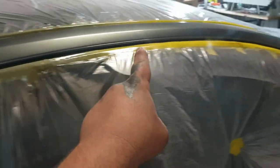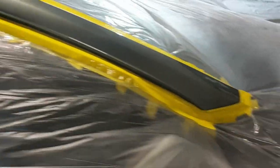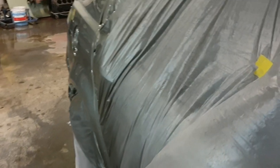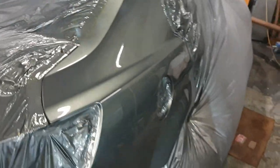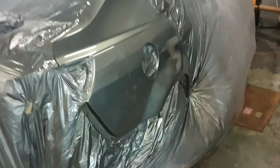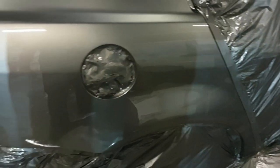You can see where the base coat stops because it's only clear at the front. The color stopped here last time, so I had to paint the color just a bit further this time to get rid of it all. There are no runs, a bit of trash but you get that on big jobs. I think that's quite passable - I may not even buff it, may leave it a week and just reassemble the car and give it a light tickle later on. No sag this time, so I call that a win - amateurs can do it.